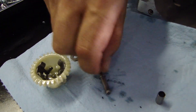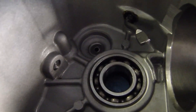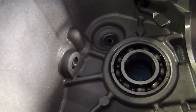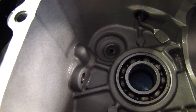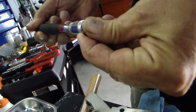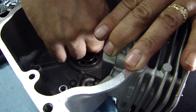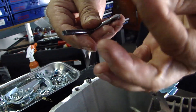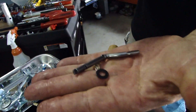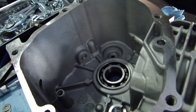Plastic gear with swing-out weights, shaft, collar, shim washer — and there you go. Now the governor is completely out, but there's a shim washer in there. They do that when they manufacture these motors to set the clearance on that governor gear. A lot of guys will take the governor gear off, get rid of the plastic part, leave the shaft, and forget about that washer that's in there. Take a magnet and pull it out — you don't want that thing bouncing around inside the motor after you put it all back together. Take a pair of pliers, pull off the clip, governor rod comes out. Give it a little wiggle — that too has a shim washer in it. Make sure you get that out. Make sure there's nothing else up in there, just some assembly lube from when they built the motor.